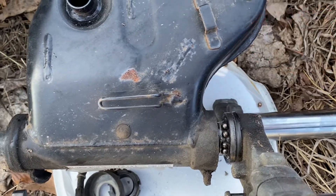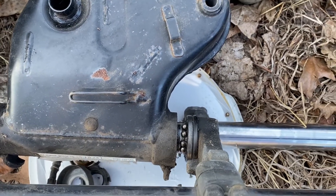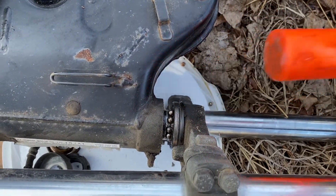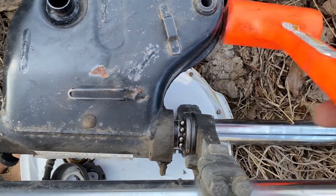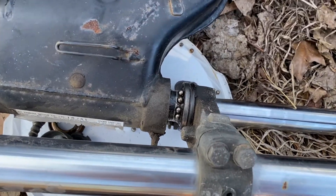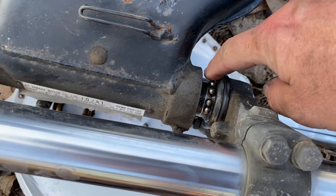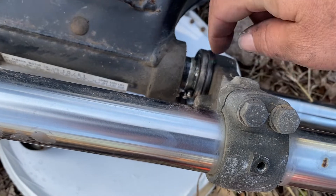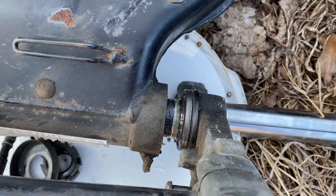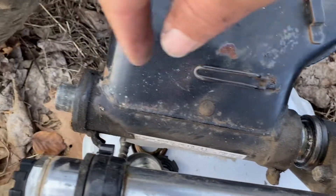Right now this frame can be lifted off of the front end. This is your steering — what makes it smooth. If these bearings aren't greased properly, or are out of round, out of place, or busted in any way, the steering isn't going to work. When you rebuild your steering, you're putting in new bearings here and a bearing up top.